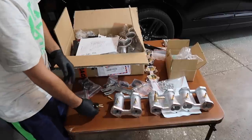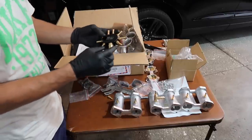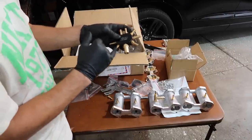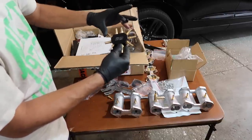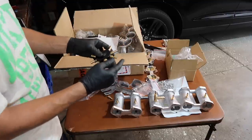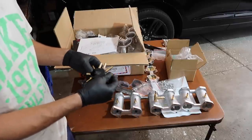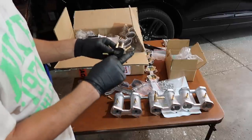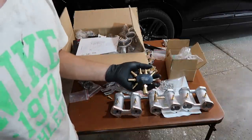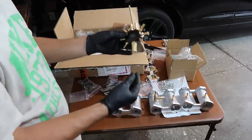So I have this basically in the way I think it's supposed to go. You have the RHD vacuum block. So you have one huge inlet. This is your ICV. You have a tiny inlet. This is your FPR. Then you have your six runners right here. 1, 2, 3, 4, 5, 6. And then it says on the diagram charcoal canister. I don't even think that this car has a charcoal canister, the E28. So that is going to run to my ECU because I'd rather have my map sensor working than a charcoal canister. So this, I believe, is set up properly.